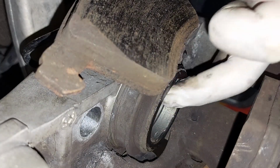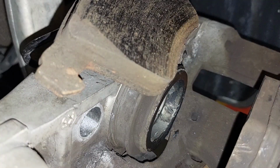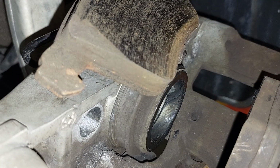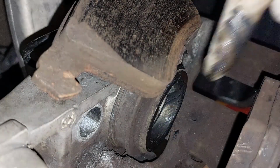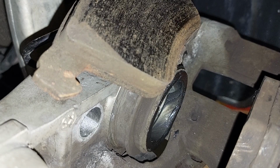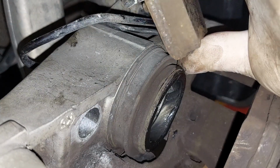Okay. Anywhere where contacts are made, okay? Even on the inside. You gotta remember, the brake pad sits on the inside of that area. Make sure you don't touch your other brake pad with it, or else pretty much you won't have any brakes. Okay. I'll wipe those down just in case. And then same thing, you want to put some assembly on the contact points of the brake pad.